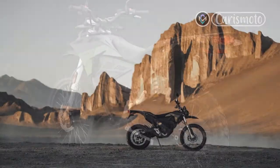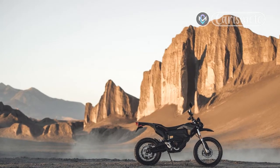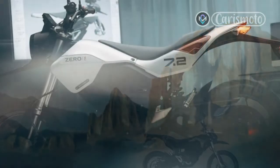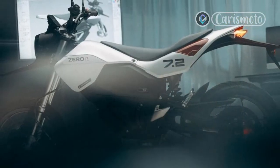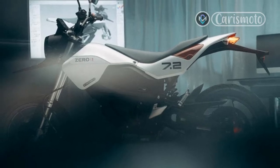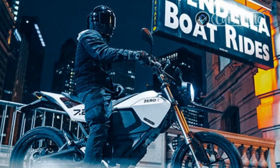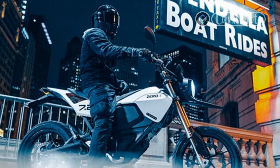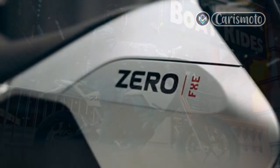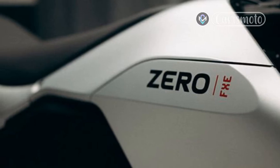The brakes are manufactured by J.Juan in Barcelona. Up front, a twin-piston floating caliper grabs a single 320mm disc that's mounted directly to the front wheel. There's no carrier. At the back, there's a single-piston floating caliper on a 240mm disc. On the spec sheet, this could seem almost quaint, but a sub-140 kilogram, sub-85 miles per hour motorcycle doesn't require any more. And, thanks to braided steel lines, the feel and initial bite of the front brake is good. The ABS system is Bosch Gen 9.